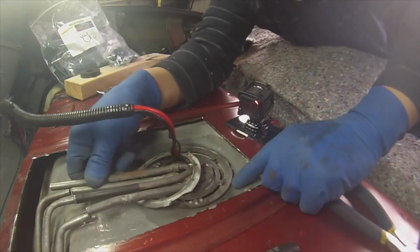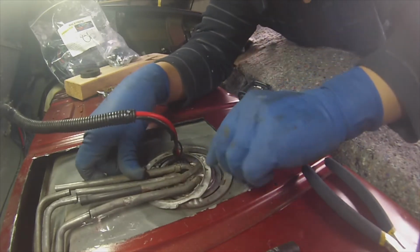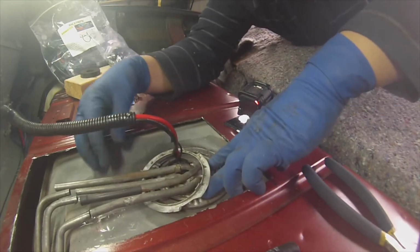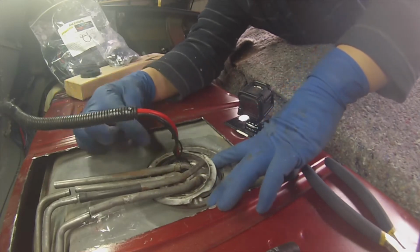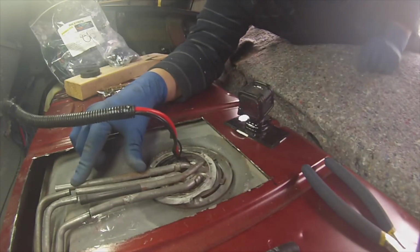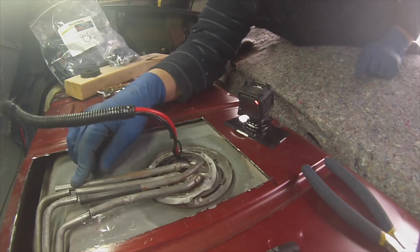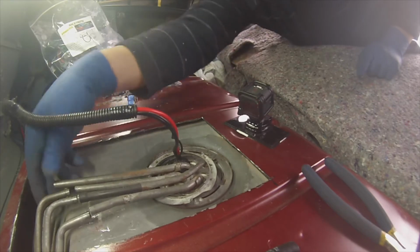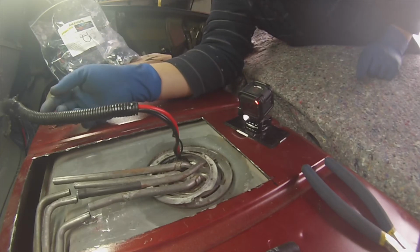The pump itself fits into these grooves. You can see each groove there. And you push them down, and then you put the ring in and slide the ring all the way around. I'll show you that in a minute. First off, I'm going to get the hoses on in place. That might take me a minute. I may end up just double or triple speeding this part, so bear with me. I'll leave the cameras running so people can see what's going on, but for the most part it's just sliding hoses into place.